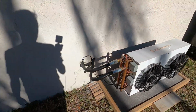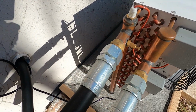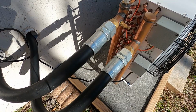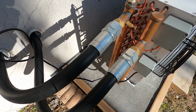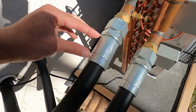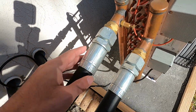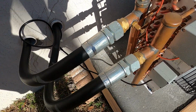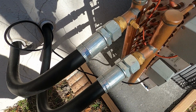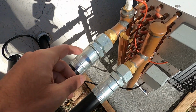Outside now, it's going to be a little bit windy. Sorry if the mic is getting some of it. But as you can see, these fittings are nickel. One of the theories is that the nickel is leaching into the system. As the fluid goes through these hoses, which is just rubber, it gets to this point right here, touching the nickel, and then it's leaching into the system. That could be bad if the parts per million count, or the amount of nickel in the system, climbs extraordinarily high, as long as it doesn't get any yellower than what it is right now.